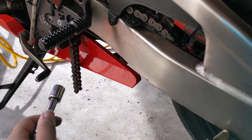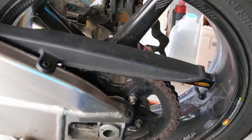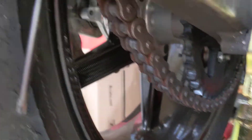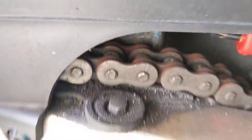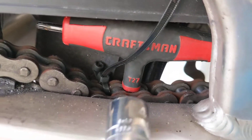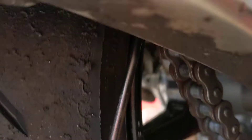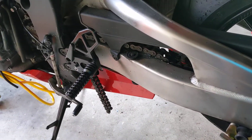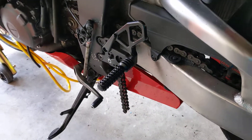What I did after cutting the chain too early was keep the wheel on. I wrapped the back end of the cut chain and zip-tied it to the top of the chain — you can see the zip tie. Then I stuck a screwdriver straight through both the top and the bottom of the chain.